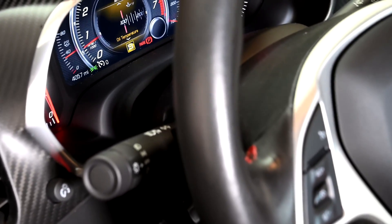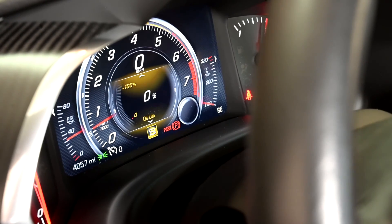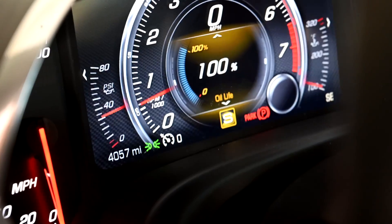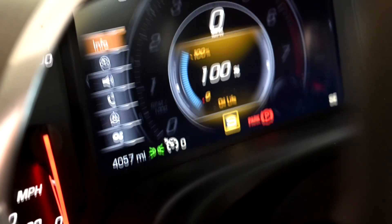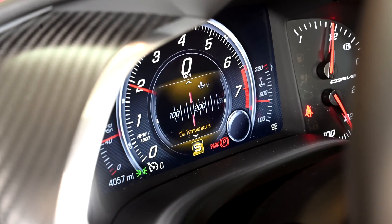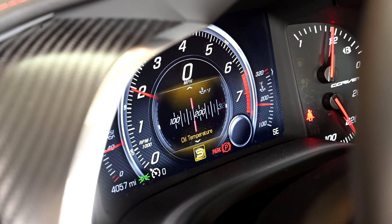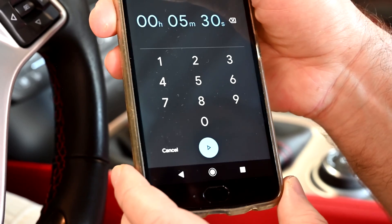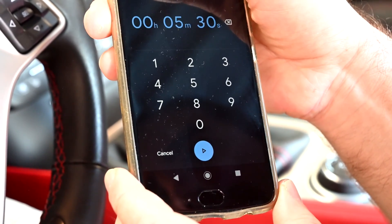Zoom in on the oil temperature and let the engine run until it gets up to 175 degrees — that should be the third mark. It's also very important that you reset the oil life monitoring system. Press and hold the select button to reset it. To get to the oil temperature menu, go to the performance menu — and there it is. Once the engine is at temperature, we turn it off and set a timer for five minutes and thirty seconds, because that's how long you have to take your measurement. If you wait too long, you'll have to turn the engine back on to heat the oil back up, since it has to be at 175 degrees minimum.